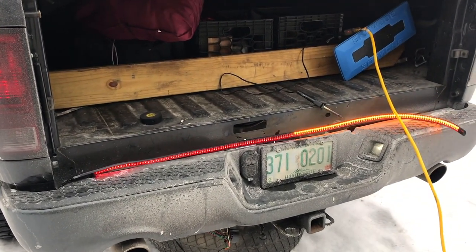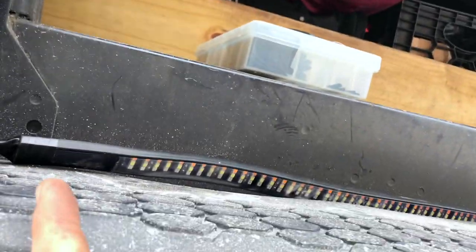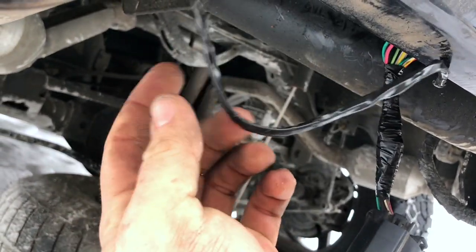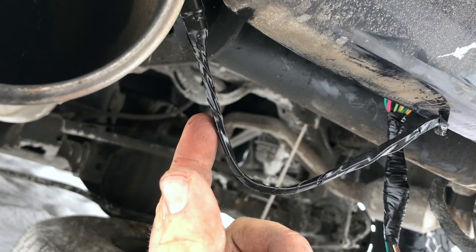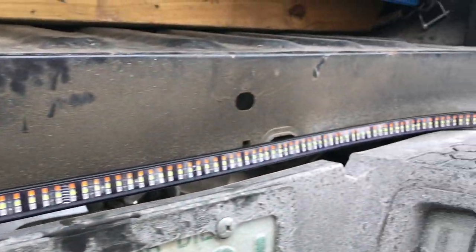We got all the splices complete and it's all wrapped up. This is the wire coming from the brake light strip — it runs up behind the bumper up to the strip. We're going to plug this stuff back in and then fasten how the wire is going to be run after we stick the tail light strip onto the truck. Wires are all tucked up — we do have a bunch of excess from the strip, and this is going to get stuck right along the bottom here.